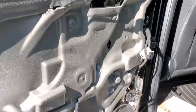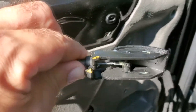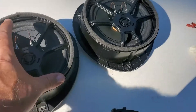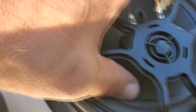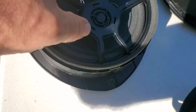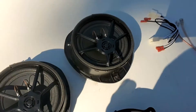I'm doing the other side and decided to go ahead and take the door panel off — it's easier to work with it off. When I went to pull this out, this whole clip came out, which maybe is what's supposed to happen. I went ahead and pulled the rest of the connectors off, and this should go much quicker. The other one sounded good already — I could tell there was an improvement. I got the speaker out, this was the one I thought was blown, and sure enough, if you push the cone down you can hear it making this sound. Push the other side and it's nice and quiet. That one was definitely a problem.